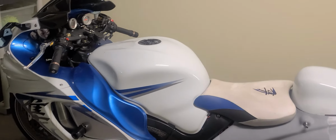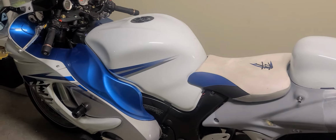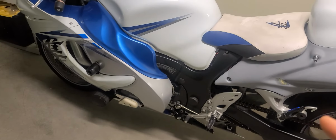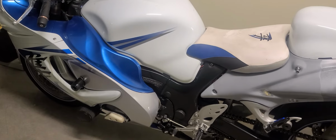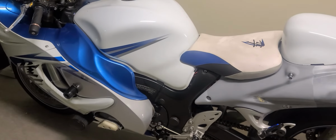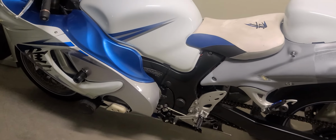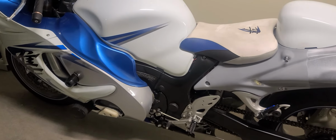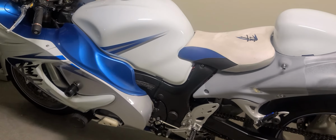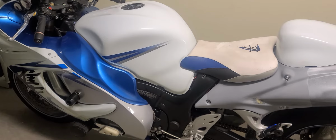I have noticed my biggest thing after riding this bike was my transmission. The very first time I rode it, I had JT Gibson undercut the transmission, up and down shifts. That thing is unbelievably smooth. I will say it's definitely worth the money if you take your bike apart to have your transmission undercut. Within the first quarter mile of riding the bike after 2.5 years was the first thing I noticed.